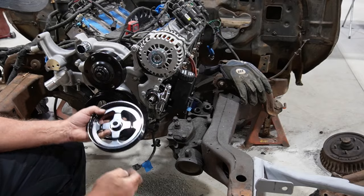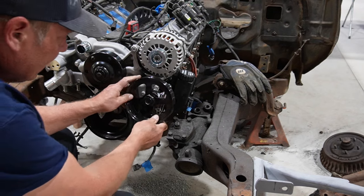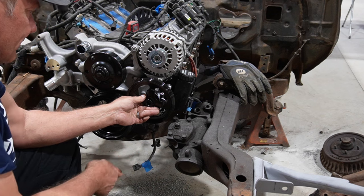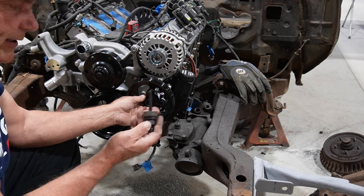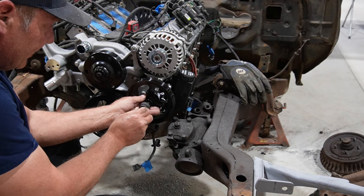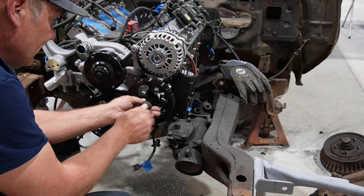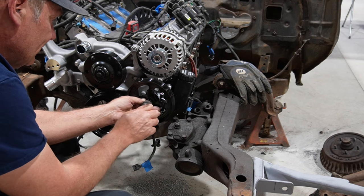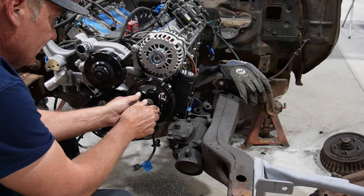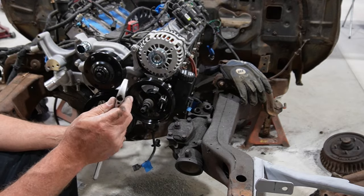All right, putting this pulley on, want to make sure that you get the little divots going in. But these are always like a tapered fit. You just want to tighten them down until it's seated all the way down. I got the pulley pusher runner installer thingy I've had for a couple hundred years. They all basically use the same threads on the inside. Just thread it down all the way, and we'll get pushing on this with that size.